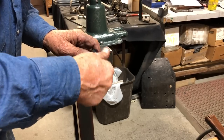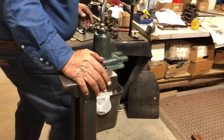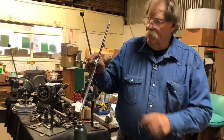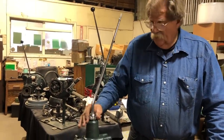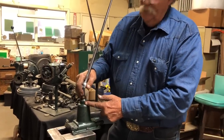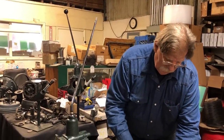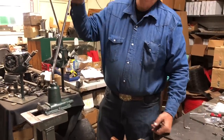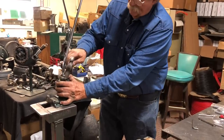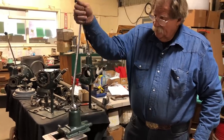These plugs just tighten down in the tower. Then we also have to put the top cap on — the cap is important because it keeps that shift rail piece from running out, and if it runs out it lets your tower move around. I make it so it's not quite so round — it typically seems to work pretty well — so you've got a nice tight fit. That is basically the rebuild on a standard Model A shift tower.